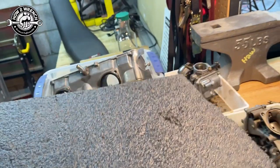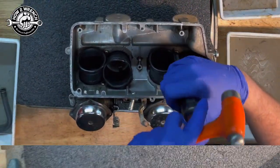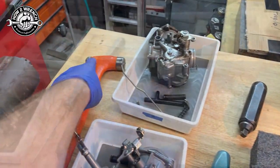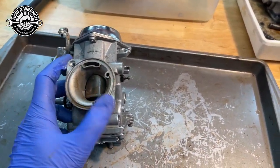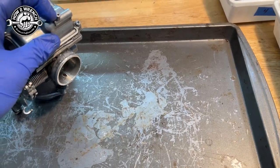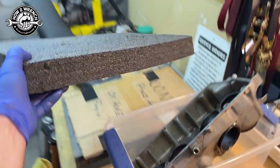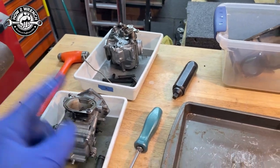Another tool not in the service manual is something like this — a big old giant chunk of foam. When you're using an impact driver and you're trying to break those screws on a manifold where you want to bang down inside, they're always a fat number three or whatnot and you're having to whack on pretty good with a hammer. I see people all the time setting the carb body up like this and smacking with a hammer — there's a really good chance you're going to pop off and break a nipple on the carb. There's just no way you want metal to metal when you're banging around with the impact. Stack up on shipping supplies or similar — it's a really handy tool to keep you from breaking something you didn't mean to.